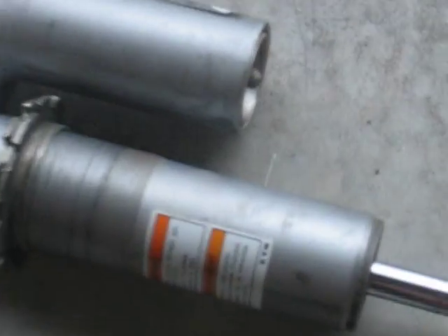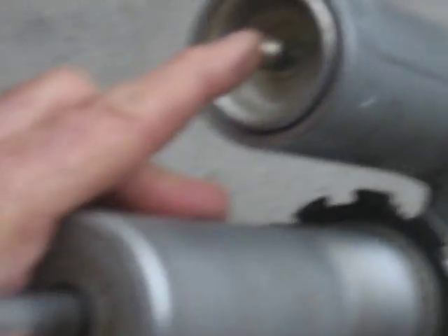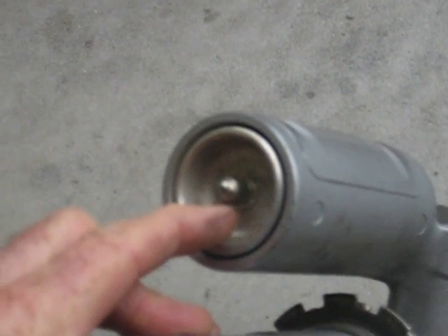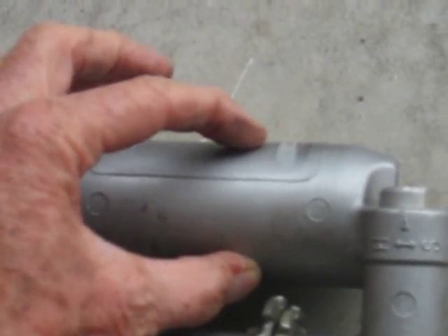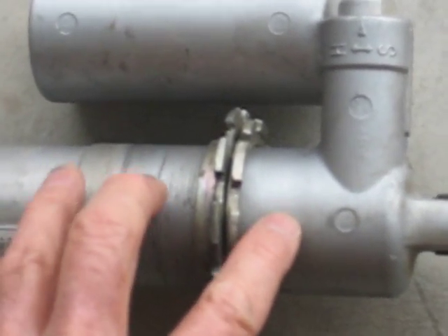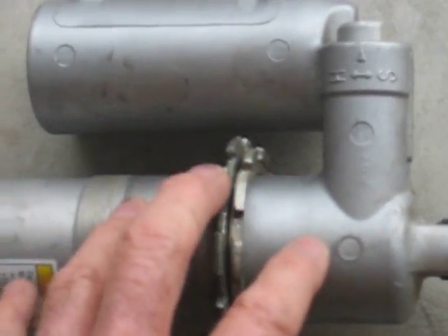Then I'm going to proceed to take the shock apart after it's clean. The first thing I want to do is at the reservoir right here — the Schrader valve. I'm going to unscrew that and bleed off all the nitrogen pressure. Inside there's a bladder charged with about 150 psi of nitrogen, and the oil is on this part right in here. The nitrogen helps stabilize the damping and minimizes foaming of the oil during the bleeding process upon assembly.